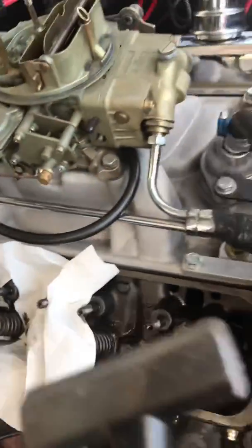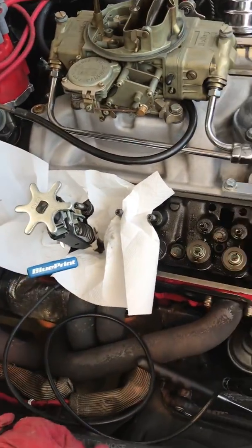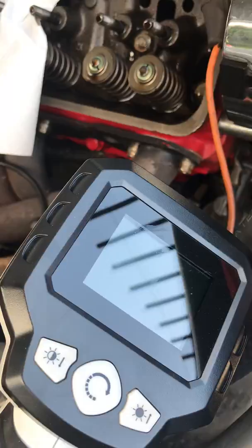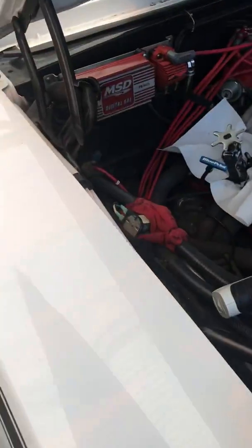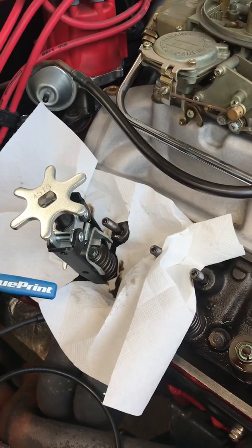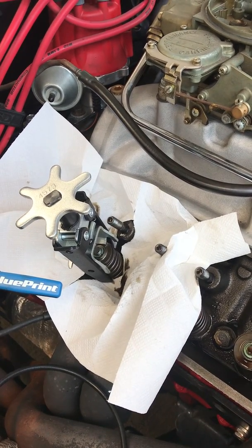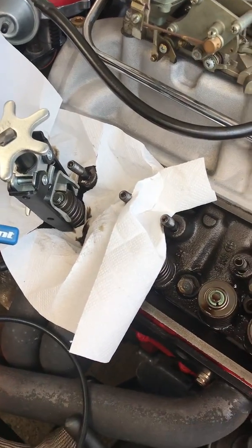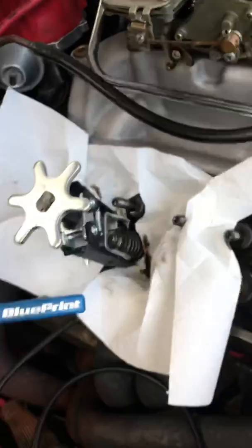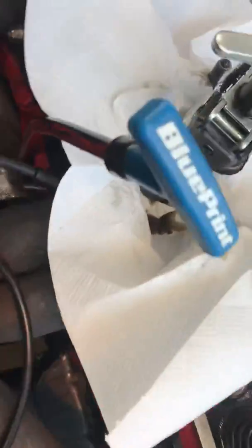Take the hammer and gently hit to knock the keepers and locks a little bit. You want to scope the cylinder if you can first, after you pull the plugs. I've got a specific scope tool I use. You're going to need a small block five-eighths socket to pull the rocker arms off. Before you work on the springs, pull the plugs, then get a long enough socket extension handle to turn the crank by hand.